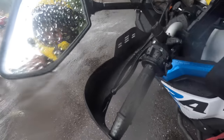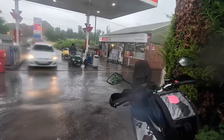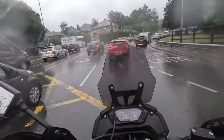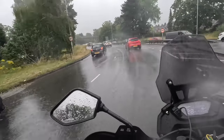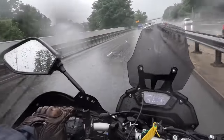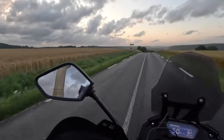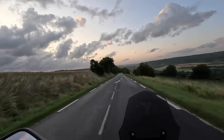You can feel a tingle through the bars and it's a bit buzzy above 60. I did about two and a half hours of riding before I needed to stop for fuel, starting to get tingly fingers. That initial feedback about the engine being a bit buzzy on the motorway is true, though it could be softened by putting on taller gearing — a bigger front sprocket or a couple down on the rear — to relax its revs. The bike was fine overall: very stable, the screen works, and it would hold 70 mph comfortably and 75 if pushed.